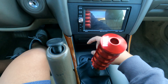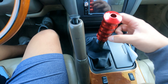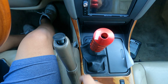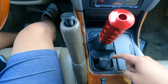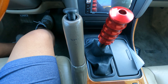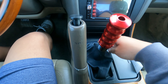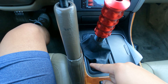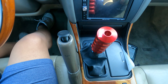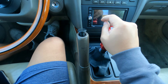What I did was have the homie shift the extender housing, and now it comes out perfectly in the center of the hole. So this is the three-inch extension — you can see it comes out perfectly centered in this area. A lot of people will say four inches, and four inches will come out perfectly centered a bit further. Lightning Speed Shop does sell a conversion shift boot where it turns the front part into a cubby and makes it perfectly square. I went with the three-inch extension, and you can see it sits in gear real nice.